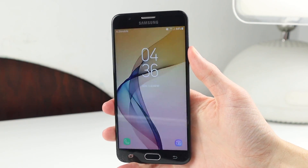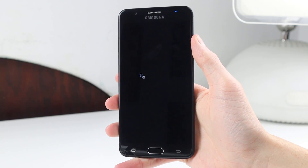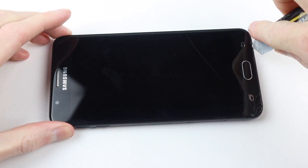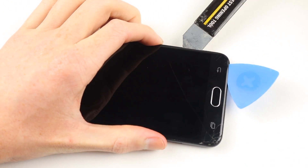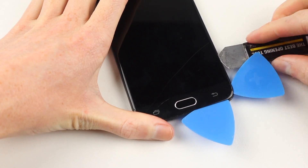Since this isn't my device, it's time to power it off and do some repairs. The first thing I'm going to do is take the screen off, and unfortunately it's glued down similar to an iPad or iPod. So I'll need to use a heat gun or heat source of some kind — I'm actually using a solder rework station for this — then I'll use a metal pry tool just to get underneath the glass and lift it up a little bit.